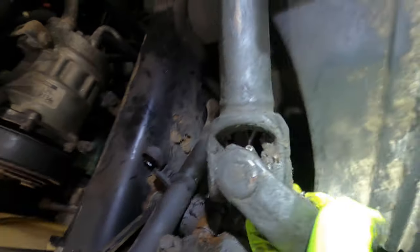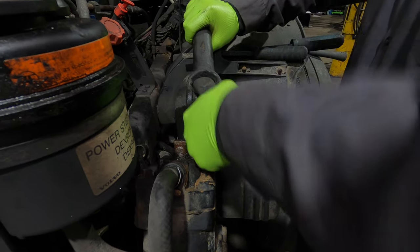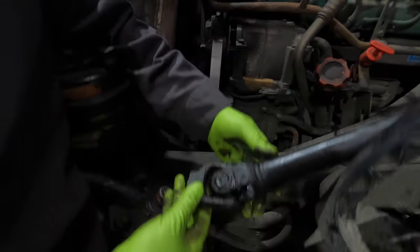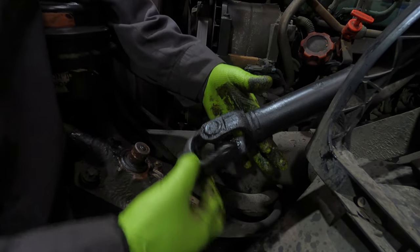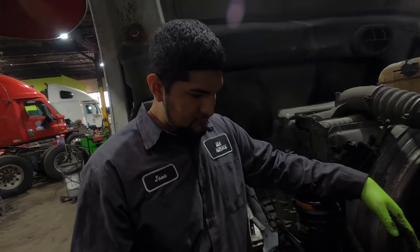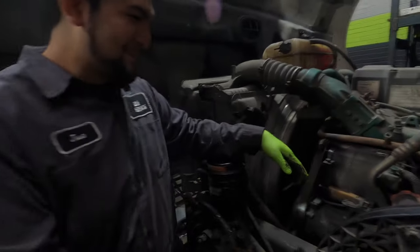As you can see, it has movement to the sides but nothing at all the other way. That's why it was locking up. It's common on the Volvos. Also, there's one bolt — if you don't tighten it up you're going to have a big problem. Check your steering shaft U-joint.